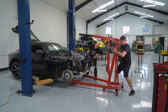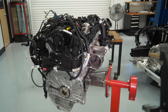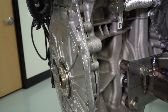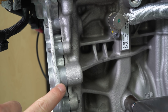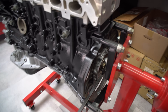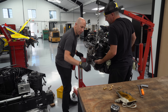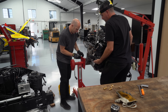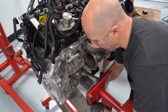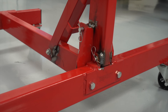The first thing that came up when we got the engine out was we couldn't mount it on our normal engine stand, because the timing chain runs from the crankshaft up to the cam gears on the backside of the engine where the transmission mounts. Since we usually bolt the engine stand there, we had to fabricate a bracket that goes from the engine stand to the motor mount bolts on the side of the block. We also found the engine stand was flexing quite a bit, so we added welds to make it more rigid, which worked pretty well.